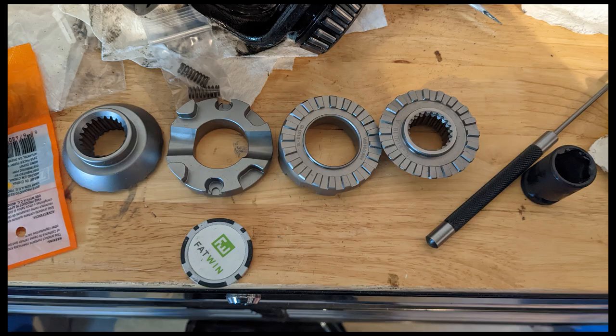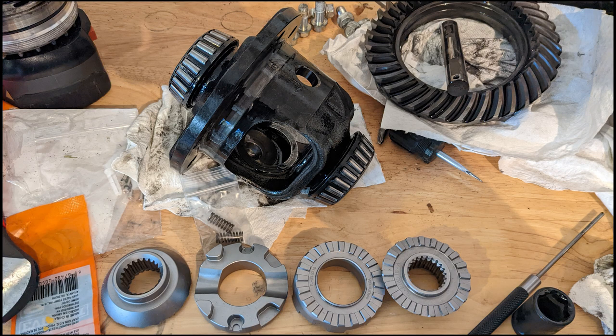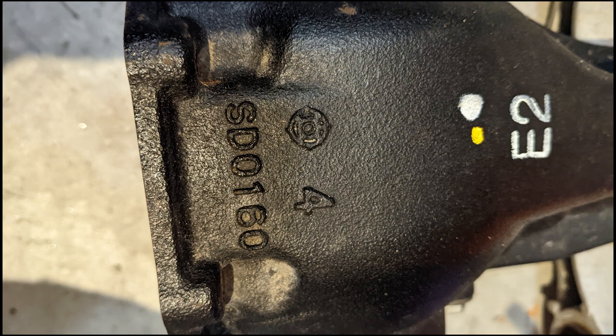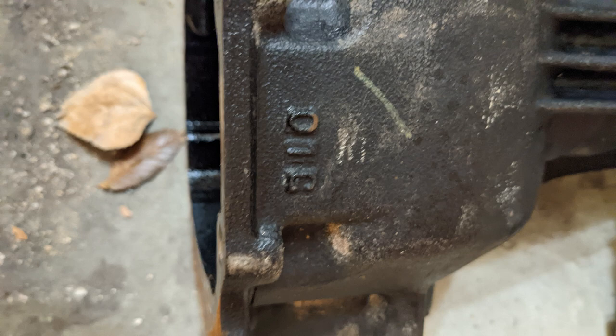I have no idea where this poker chip came from. Slide out your spider gears from the side — just make sure you don't lose that little thrust washer that's on each side, and try to maintain the position for each of those. Set the one on the right to the right, and the one on the left to the left. And bummer — super excited to change the carrier after about 20 years of using the same one, and it just happened on the 2020 model. I can absolutely confirm that the TL-1601B does not fit in the XT carriers.